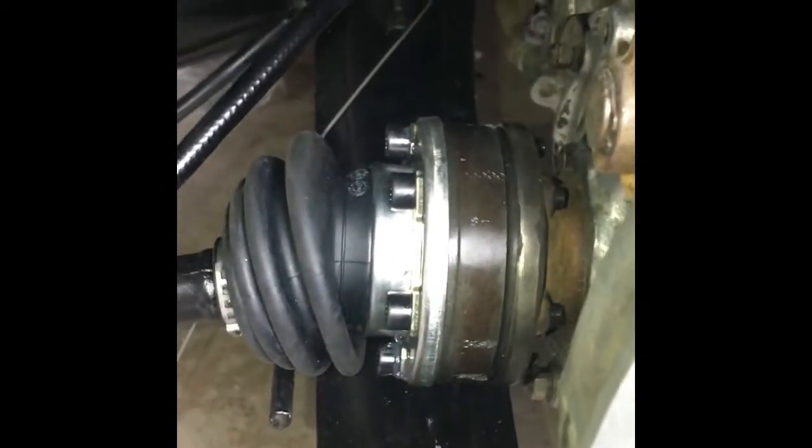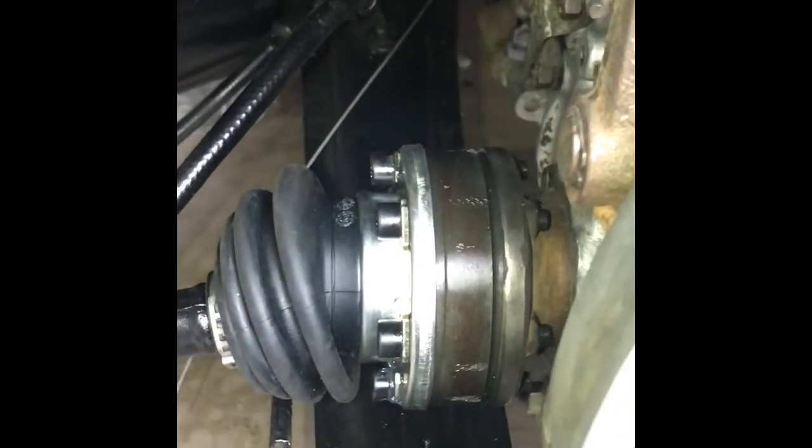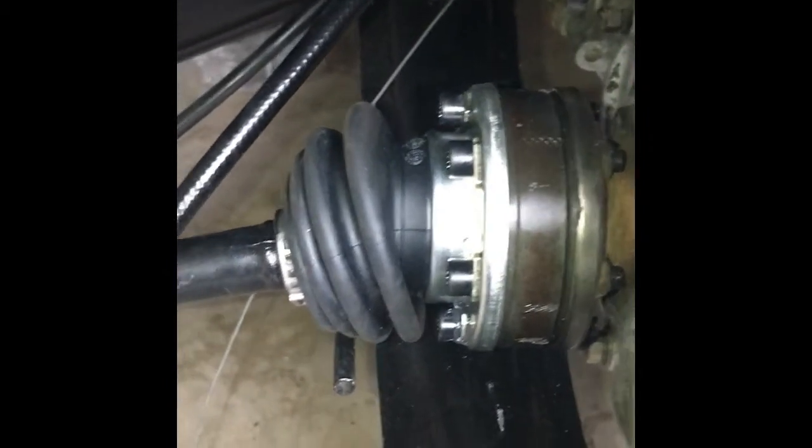We have some rain in Columbus, Ohio. Yesterday I ran out of battery, but I wanted to install these axles last night to be done with it. I went ahead and installed the CV joints and torqued them to 25 foot-pounds all over — here, there, and there. So that's what we have going right now for Sonny the Super Beetle.